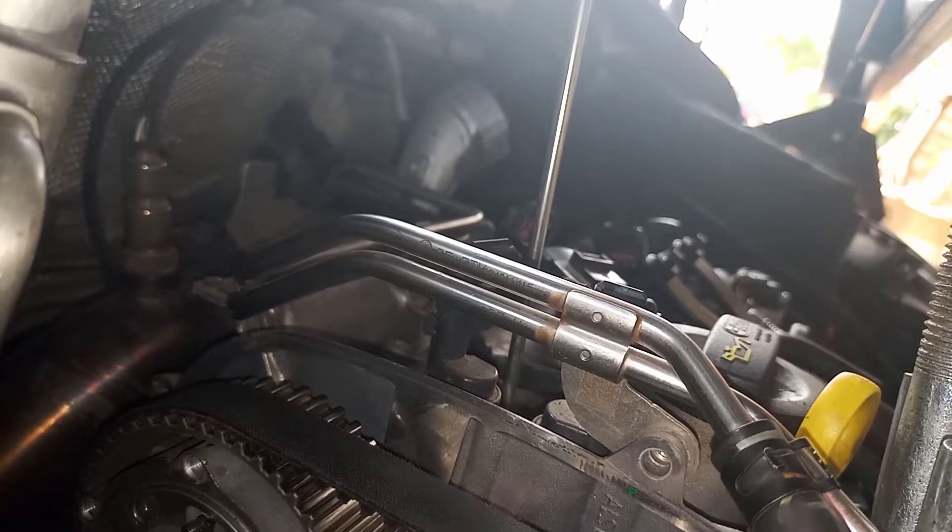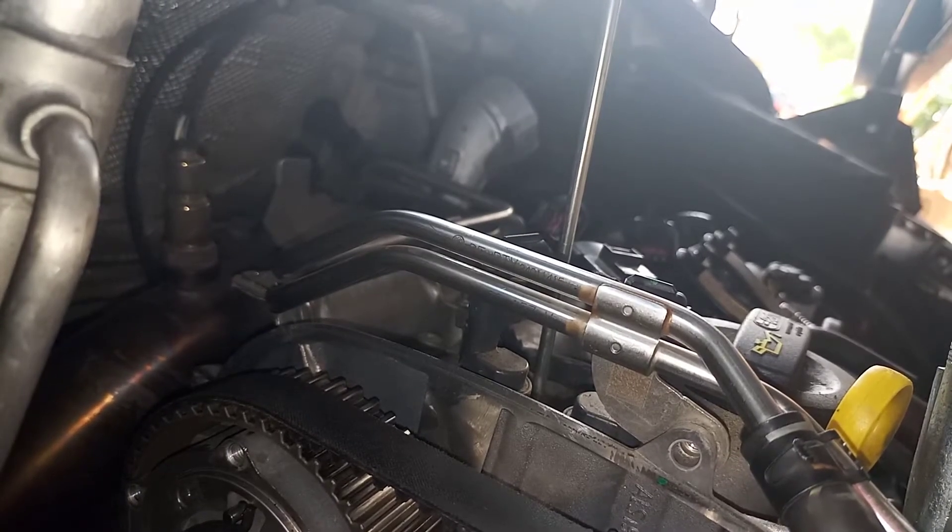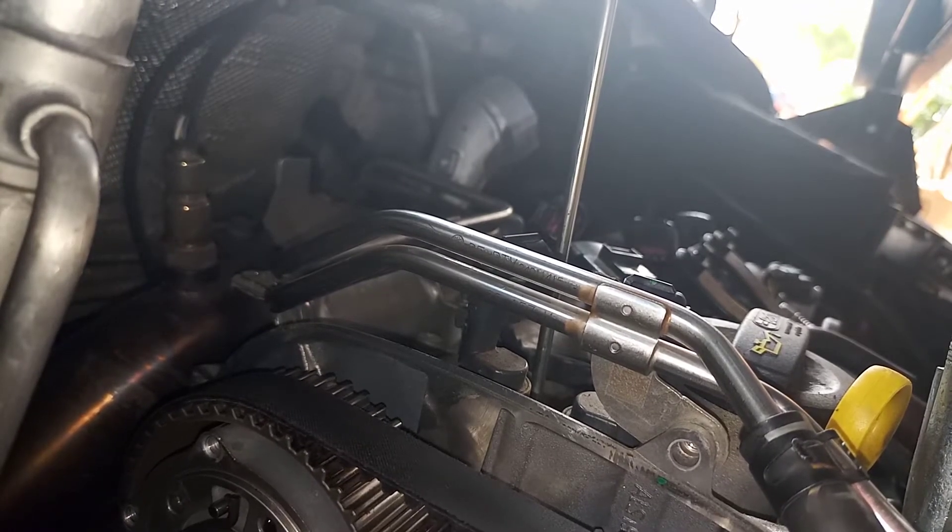At the bottom of the crank there, we're just gonna slack up a little bit. Notice how it's traveling down and then climbing back up — we hit the marker right there, so we know that that is TDC.